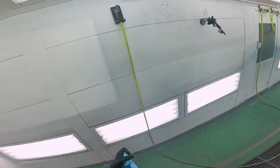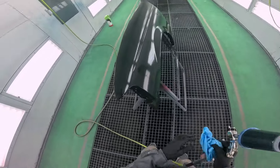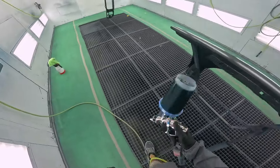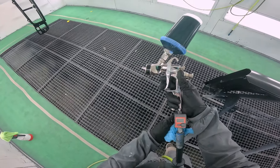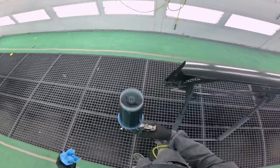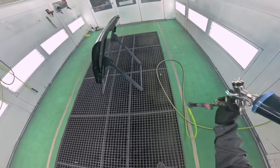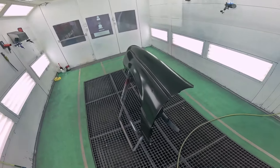All right, so this is nice and dry now. Take your glove finger and you're just going to rub across it — we're good. I'm going to set my pressure here wide open, everything. We're going to spray our base coat at 22 PSI. Always just start at your edges — if you're new to this, that's the best thing to do: spray all of your edges first, then worry about the face.